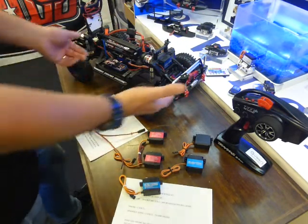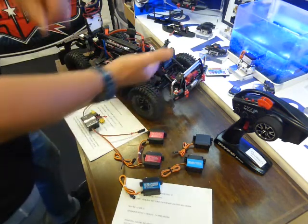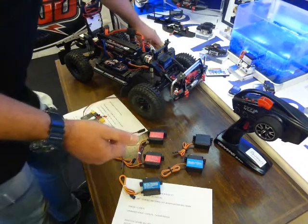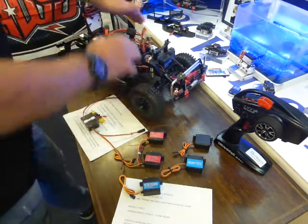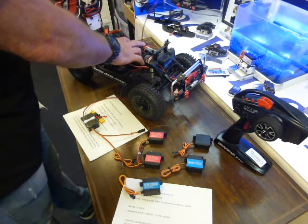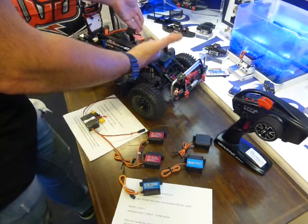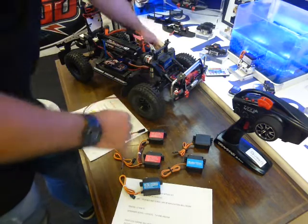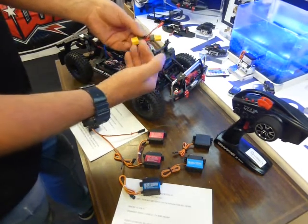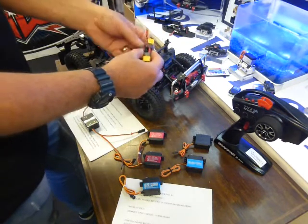Here's one of our demo cars — a fairly standard TRX4 with a bumper on the front and a winch. It has a Savox servo plugged directly into the receiver, so it only gets 5 volts. If you're running stock electrics, the XL5 ESC has a little JST plug on the side, mainly used for the Traxxas lighting kit, but this is where the servo bypass kit plugs in. For different ESCs with different battery connectors, we can do XT90 link leads with a JST splitter. We do these in XT90, XT60, and Deans, with one, two, or three tails, so if you're running lighting kits and other electrics you can still spur off — not a problem.